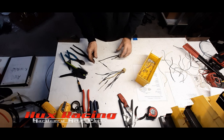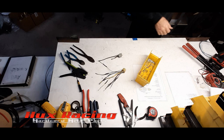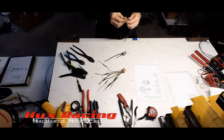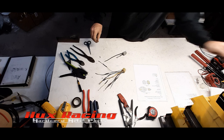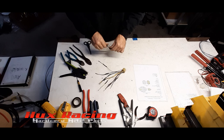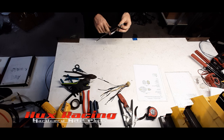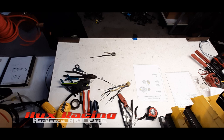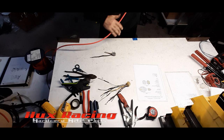Okay. Get these other wires off the table. Gone. Okay. Now, that one. Now, from experience, I know 55 inches from the edge of this connector to the end of this cable, actually, I should say to the end of this cable for the battery relocation into the trunk. And I have some 6-gauge cable here. 6-gauge is probably overkill. You could probably easily just get away running an 8-gauge. It's really just power feed to the front half of the car.